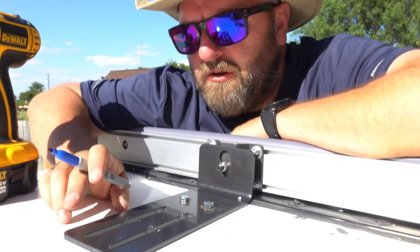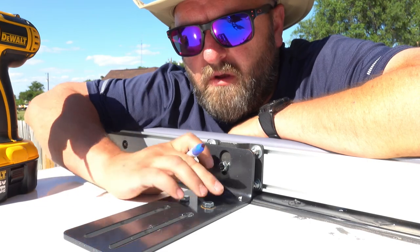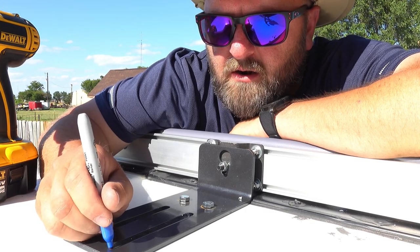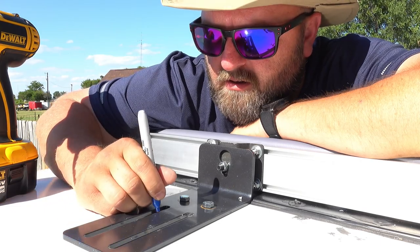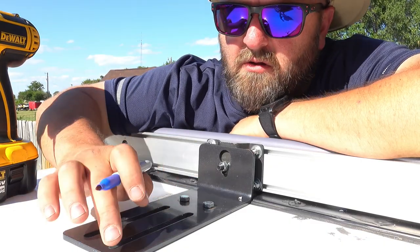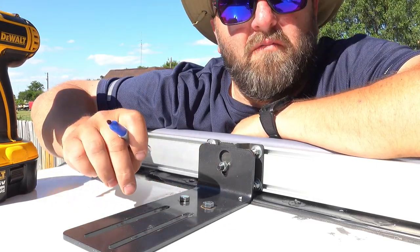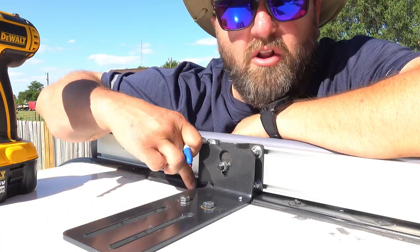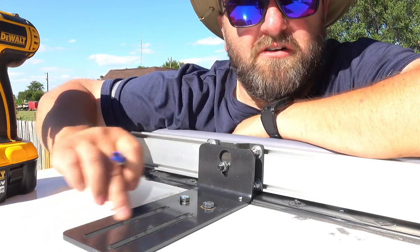Okay, one thing I'm going to try before removing the plate, so that way I know where the plate is so I can go ahead and put some sealant down, is I'm going to mark where my holes are, or the edges, so I can have an outline to get a nice little row of sealant, and then place the mount on top of it, put the mount bolts in, get them tightened, and then I'll run a bead of sealant all the way around, and then I'll seal the inside of the channels here on the mount.